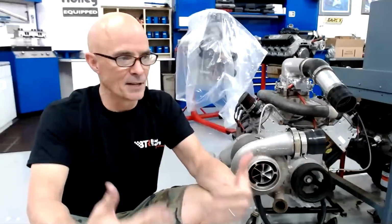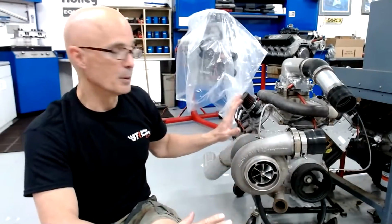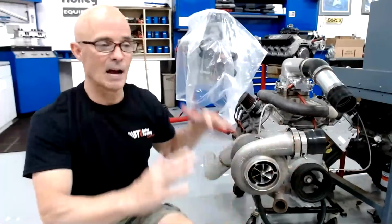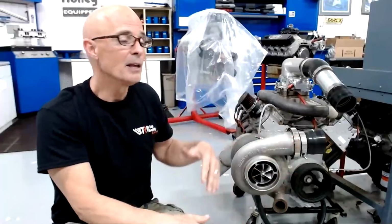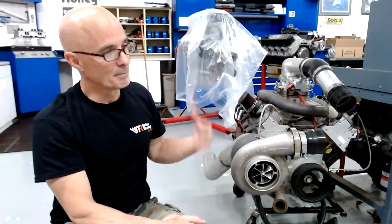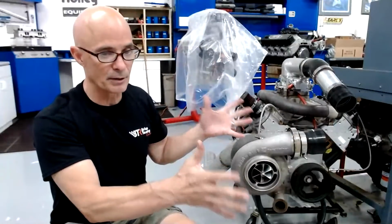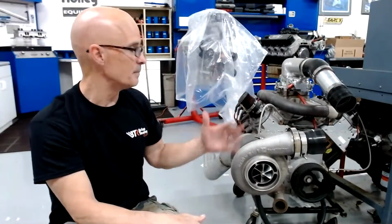This is one of the reasons, and we talked about this a little bit last night, and I've talked about it again and again and again. This is one of the reasons that I love to run any motor that I'm going to run boost on. I like to run it NA first for the reasons that we talked about last night. I want to make sure that the motor is sound, that it doesn't leak, that it doesn't misfire, that it does all the things that it's supposed to do as the motor, NA, and then we add boost to it.